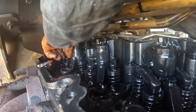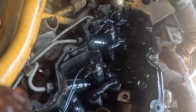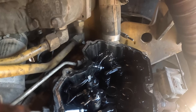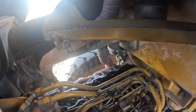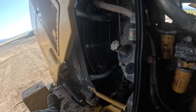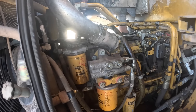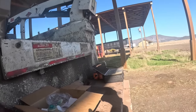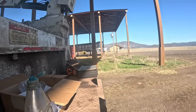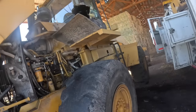I told Dwayne, look at the difference. I put the link against the bed of the truck on number five and I could push the injector link in by pushing on it. On number six, I couldn't move that son of a bitch at all. That damn injector we bought from Fleet Pride was stuck halfway down — it bent the push rod and took the cam out. The owner wasn't mad. He said he was kind of glad it happened — look at all the stuff that's wrong with this thing, it's a good thing we can rebuild it and do it right. He's going to send that injector off — we're sending all six to Oregon Fuel Injection because we don't trust them now.